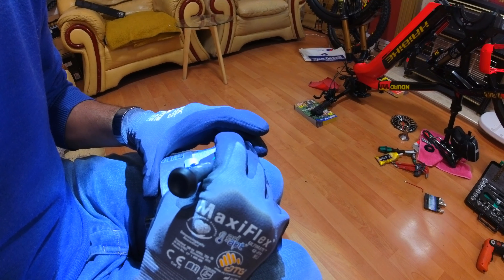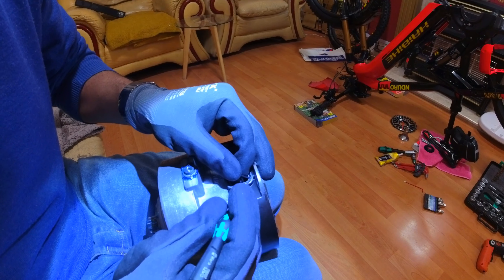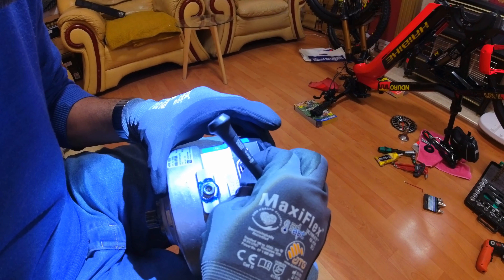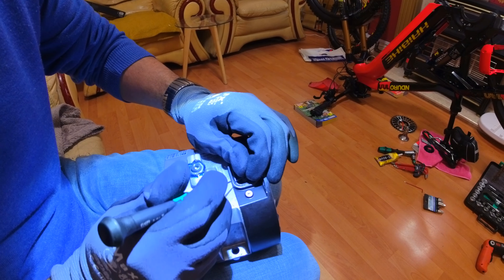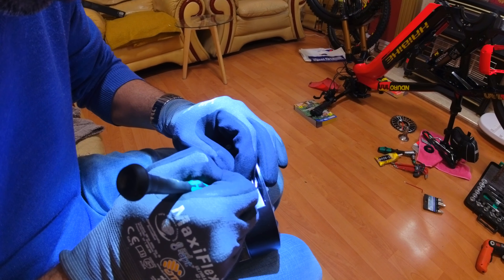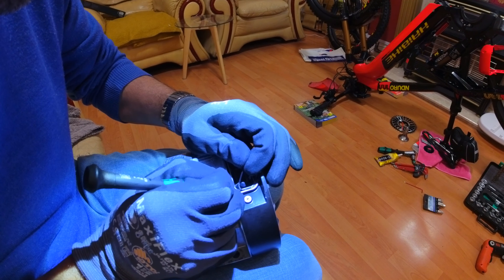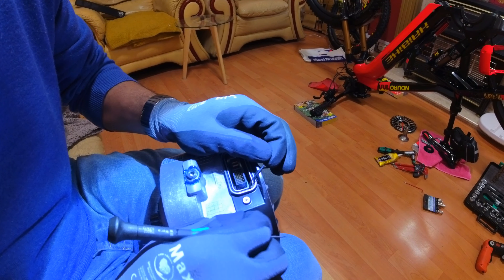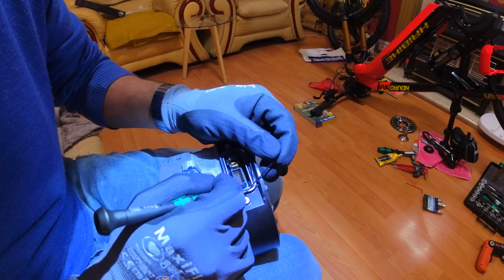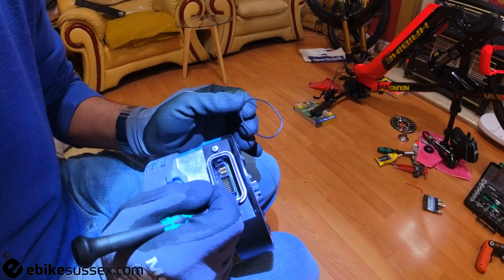Gently lift away the O-ring — there you go. The glue I used may have been applied a little too much this time. I'll trim the edges. Ideally you want to refresh this O-ring on servicing. I'm measuring the thickness — it's showing about 1.3mm, but I'd stick to 1.5mm. The difficulty is establishing the inner and outer diameter, so I've taken a template measurement and will update you.